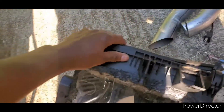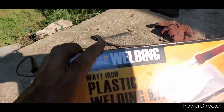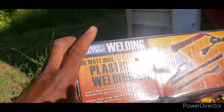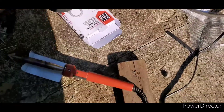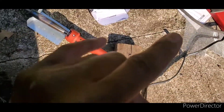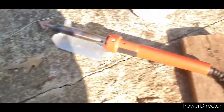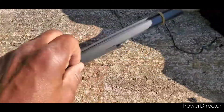I basically fixed my air intake. This is gonna be your best friend — I got it from Harbor Freight: a plastic welding kit. It's basically a hot iron gun, 80 watt, with a triangle-shaped soldering tip. It comes with these rubber sticks for welding plastic.